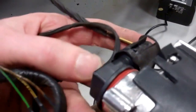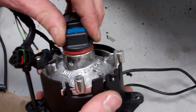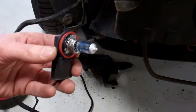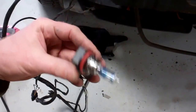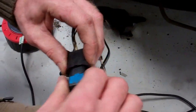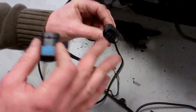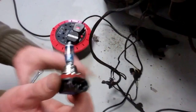Fog lights — that's even easier. The fog light bulbs in the 2010 onwards are exactly the same as these. So you can literally just take those out and those bulbs will fit in your new fog light. You disconnect it here, push those in and remove that. Then you can just plug your new fog lights in — the wires are the right length. That's easy.